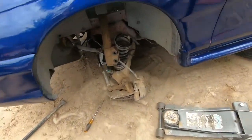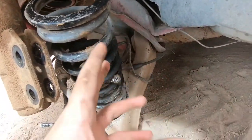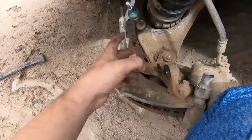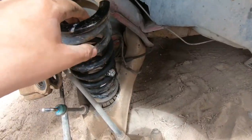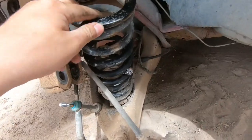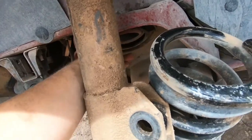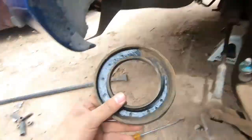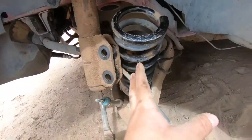I managed to take out the spring. I used something like a lock — it wasn't the best but I couldn't find the chain lock, so use something when you use a pry bar. Push it to the side, loosen the two bolts, lower it down, make sure you got jacks and a chain tight so it doesn't come out flying. The isolators weren't in as bad a shape as I thought, but since we're already doing this might as well replace them.